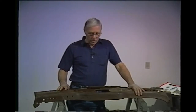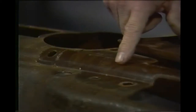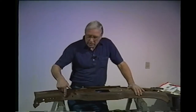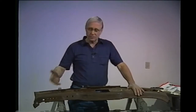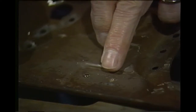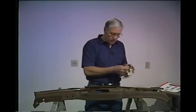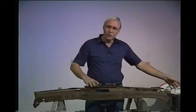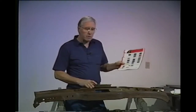The first thing you do before you get started is try to find the base coat the factory used underneath their wood grain. The place you'd look is on the bottom of the dashboard or behind the cracks or crevices. If it's rusty like this dashboard, you might find it inside the glove box like we did here. We took a little rubbing compound, cleaned that up, and we're going to take this glove box door to a paint store and have them match the color.